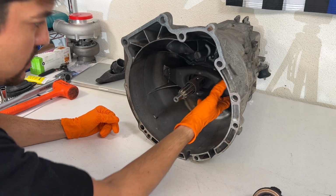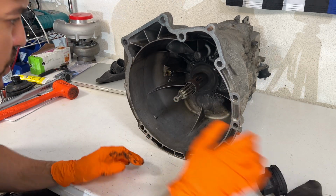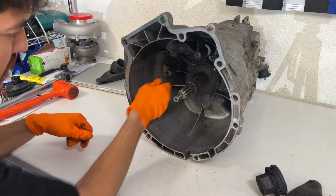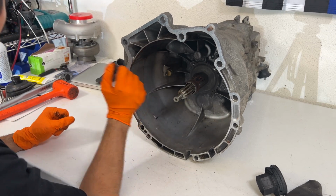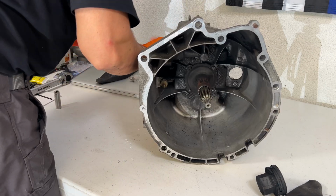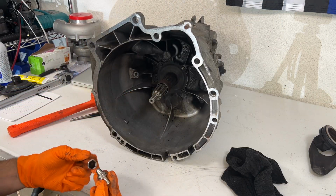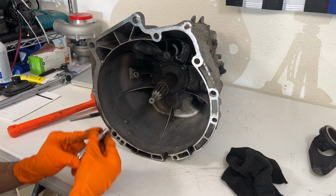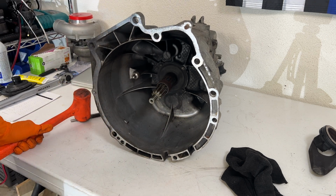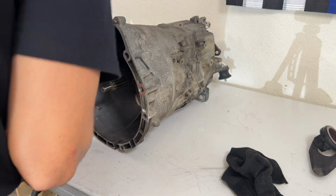Just take it out like that. Up here, separate it like this. Super dirty clutch fork. I'm gonna be replacing it with a metal one. Let's punch it out real quick. Okay, here we got our new one. Trick to pushing this in is like a little 14 mil, just like that. Might be in your way for a second, but gotta do it. That's it.